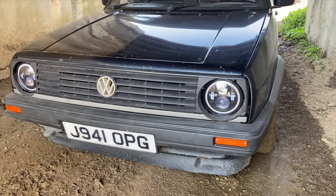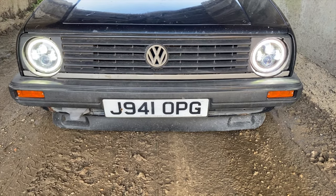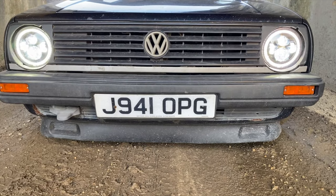I'm really happy with those lights but I do need to take them out, strip it back down, and tidy it up - paint over the cut edges so they're not going to rust in the future. This is a really good mod that didn't cost much and it's something you can definitely do yourself at home with minimal tools, as we just showed today. I'm definitely going to try it again with a second set but with the clear white ones instead. Things I'd do differently: that Dremel was useless - you're better off using an angle grinder. And to get the light fitted into the front panel, it's probably best to space it out a little with a couple of spacers. Guys, thanks for watching - remember to like the video and subscribe to the channel and I'll see you on the next one.